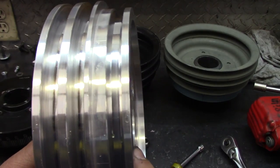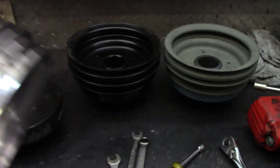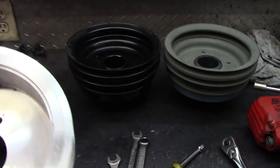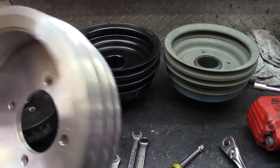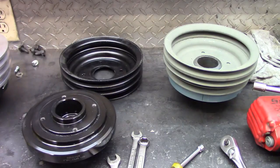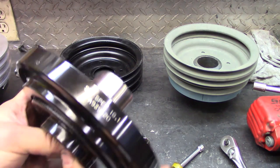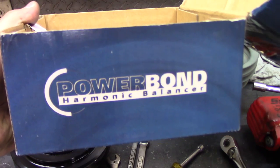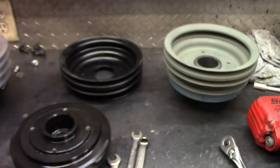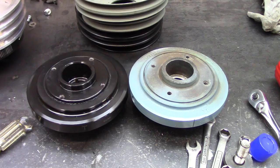It's hard to tell by the wear, but I think maybe that belt was riding in the bottom of that groove, probably causing it to slip. One other thing I didn't like is he didn't have a radius edge on the inside. It's a really nice piece for a local machine shop to make. I wanted to run an ATI but I couldn't find one that had the step in it either, so I was able to find an SFI balancer. It's a power bond - looks like the country of origin is Australia. This is really just like the Pontiac one in comparison of the two.